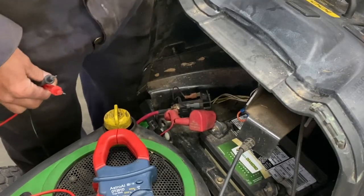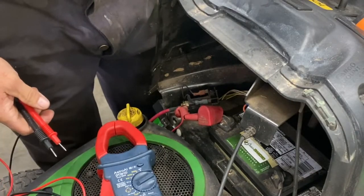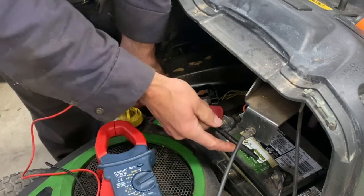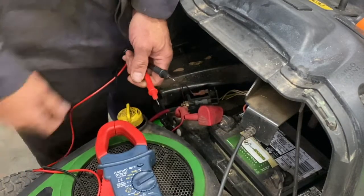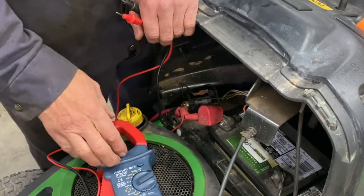Maybe it's the headlight. I'm going to put the meter on the lights, right on the light switch here. It should be 1 ohm or greater here — and it's exactly 1 ohm. So we're just measuring the bulbs, and it's not dead zero. So that's good.